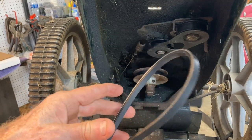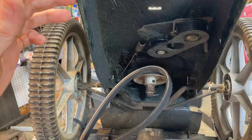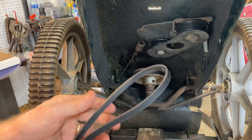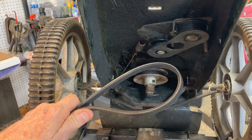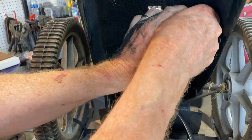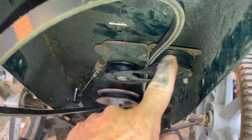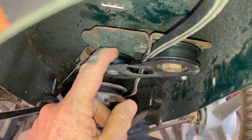Before I get it routed on here, I wanted to explain that this belt is kind of difficult to find the right one for this string trimmer. This is a Craftsman with a six horsepower Briggs and Stratton motor. The model is 917.773701. I located this belt and it works great on this mower — the link is in the description below. I had to remove the idler pulley, put the belt in behind the keeper, and then the belt slides into this pulley here.